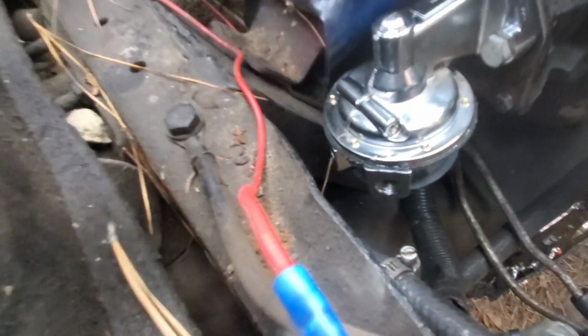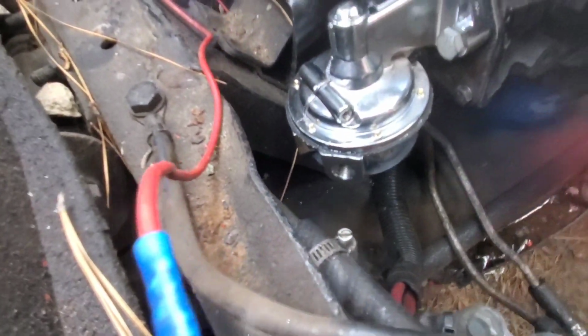The gasket on the fuel pump same way, just a little gasket maker to hold it on there. And I just went ahead and put the bolts through it, that way they wouldn't tear the holes in the gasket and mess the gasket up. Might should have got the fittings I need first, but I don't know what size they are. Now, I'm probably gonna wish I'd have went ahead and got the fittings and had them on there, because they're gonna go that way and that way. But get that line all moved out of the way. It shouldn't be too hard to get them on.